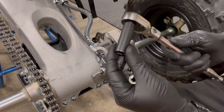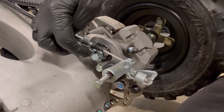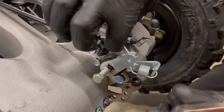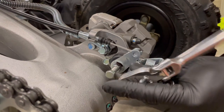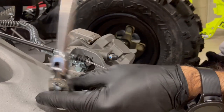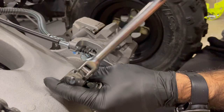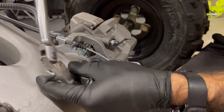We're already halfway there. Next tools: a 12mm socket, 3/8 ratchet. We're going to loosen these two bolts — not that one. Do not loosen the brake line bolt — you will leak out brake fluid and have to re-bleed your brake system. Loosen our cable — this is very easy to work with. Remove those — pretty simple system, pretty basic but effective. But it has to go — we don't need that extra cabling, that bracket, those extra switches.